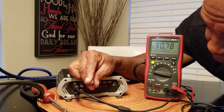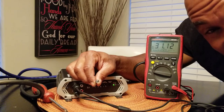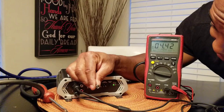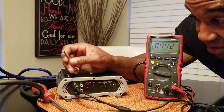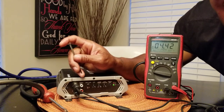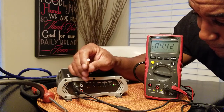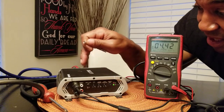So I'm going to have to show you by example. Watch this video over and over again — this is singly the most important video on my channel: how to set your amplifier so you won't be clipping. Don't let anybody set your amplifier by ear, because every song is different — every bass note is different. Some songs have 40 hertz, some have 35, some have 32, some have 38. Every dynamic is different. You cannot set an amplifier by ear on one song. What happens when you play a different song? You could be clipping. You have to set it with mathematics — electricity is mathematics.